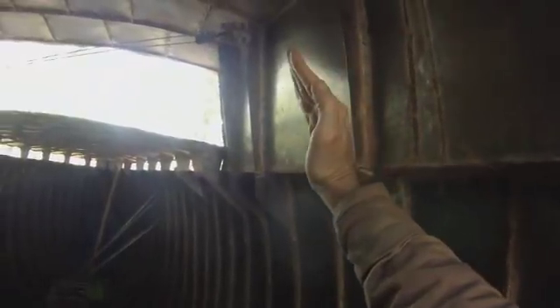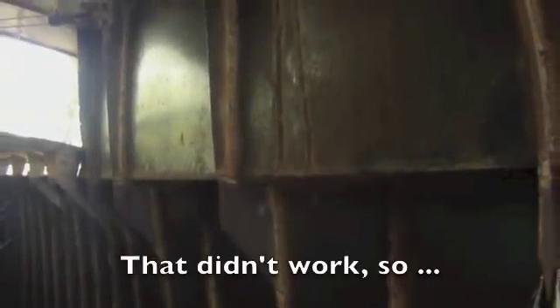So I attach these points to the top of the right side and the bottom of the left. I've got a lot of tension on them, and I'm going to weld in these spots. I'm hoping that the heat I apply to this portion of the roof — or the wall — will cause it to permanently move just half an inch. That's all I need.